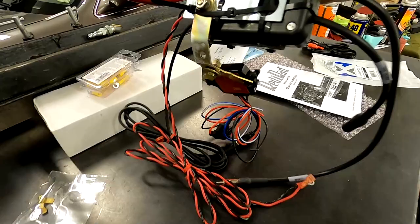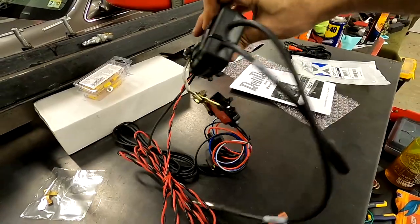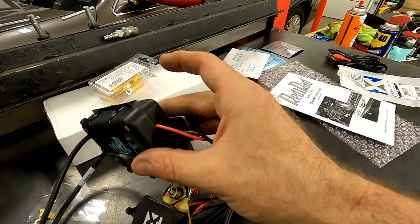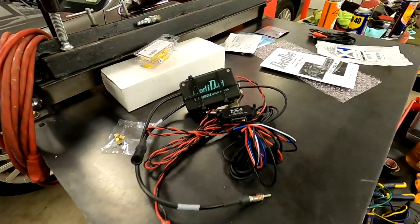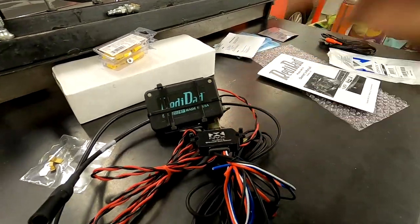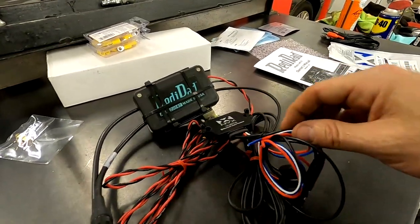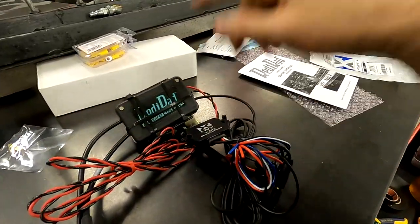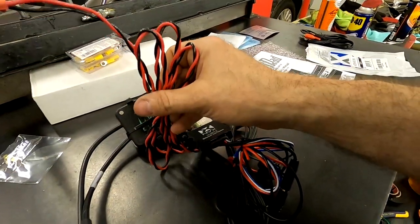It went into a back bracket bin, kind of like a bolt bin, but it's got a bunch of brackets. I found all kinds of little things and bolted them together, and I've got my RediRad on the top at an angle, and we've got our Bluetooth adapter here, and I'll show you in a second where that's going to mount in the car. Now what we're going to do is I'm actually going to leverage that stud as a ground as well. So what I'm going to do for that is take the ground wires I need off of our Bluetooth and this, which is kind of wrapped up, so I'm going to unwind it, and we're going to ground straight on here. So that way we don't have to run the ground wire all the way. All we'll have to do is run our power leads.